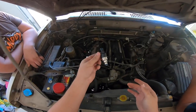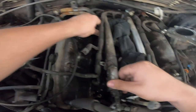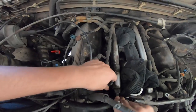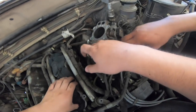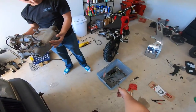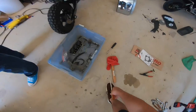Let me slide this new injector right here, down into the manifold, like so. Okay, so back injector needs to get lined back up. That injector is seated. All right, that injector is seated and connected. This side's all good still, huh? Yeah. Okay, so we have successfully changed out the injector right there. That very center injector is now installed. So it looks like all we've got to do is get started assembling all this giant box of parts. Hopefully it'll, I guess, start up. I don't know. I can give it a try at least.